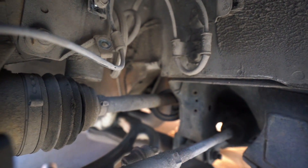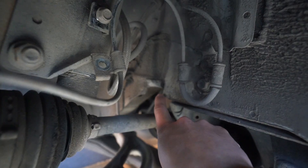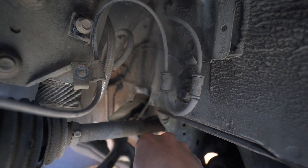We're gonna get started on this side. Another thing Ongo is doing today is lowering the strut on the bag so he's able to air out a lot lower up front. The reason he wasn't able to air out as low as he wanted was because the axle was hitting the frame, so we went over to Javi's shop and he cut a piece of the frame out so it can lower on top of the axle without hitting.